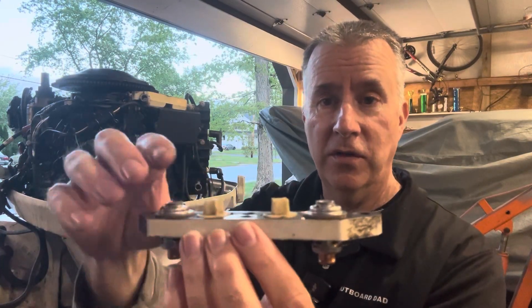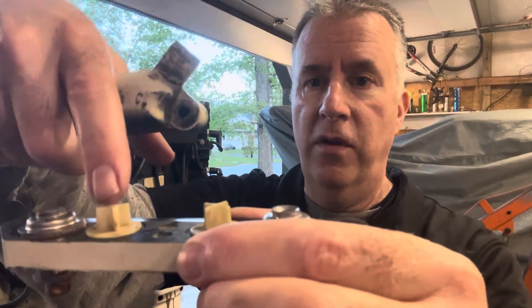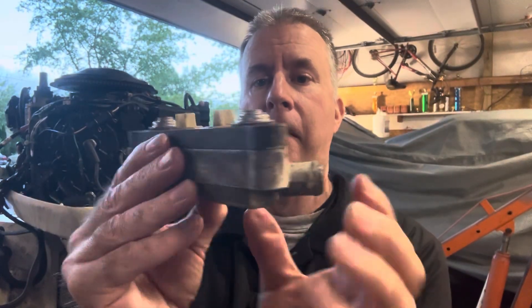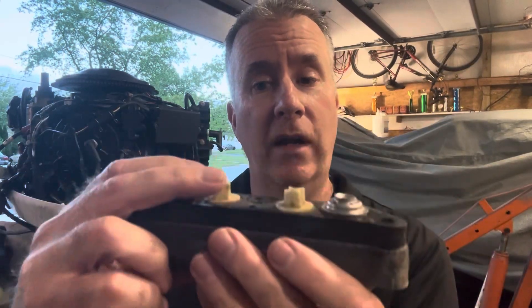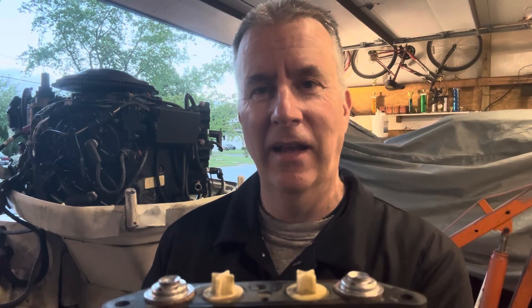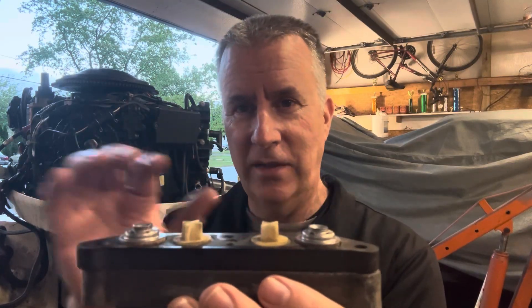We sanded this and made sure all surfaces were clean. There is a gasket on this side and a gasket on the other side. A little trick I'm going to do is take a little weather stripping adhesive and put it on either side of the cork gasket so the thermostats don't fall out while we're doing the assembly. I've wrestled with them many times before without doing that — it's just the easiest way. I'll put just enough so they stick and hold in there, being careful not to break them loose as we're fumbling around.